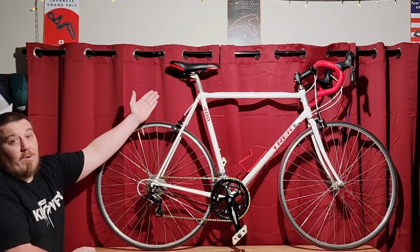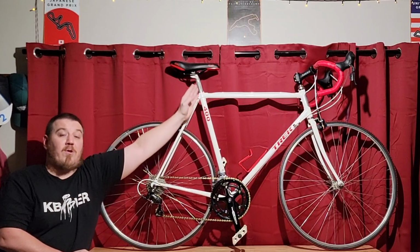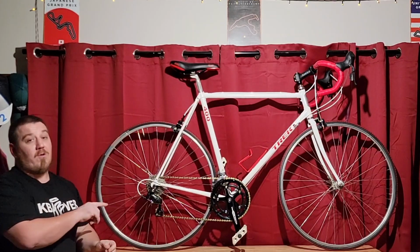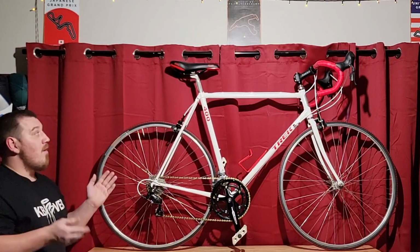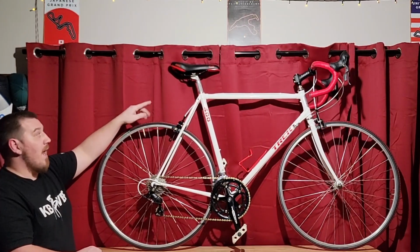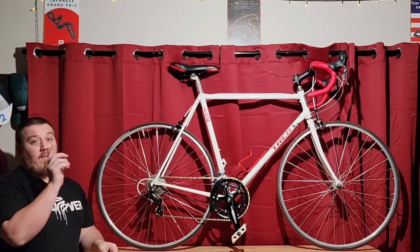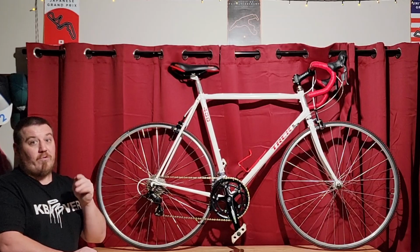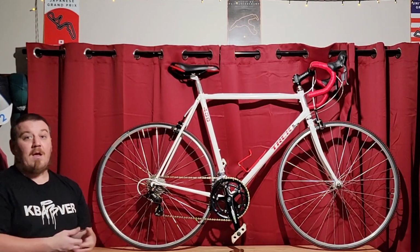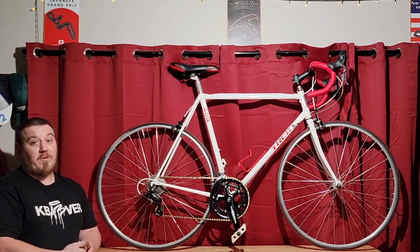Often with the seat posts as well, you could get a slight setback like this one has, or move it up forward a little bit with a zero offset. So these are things to think about. And I did not want to forget, specifically when you go steel frames, looking at budget bikes, you'll run into stuff that people don't get a lot, like this bike. This has a 26.8 millimeter seat post, so I didn't want to forget to mention that. The True Temper RC2s use the 26.8. If you go on Sheldon Brown, they say literally every American-made steel frame bike uses 27.2. There are some exceptions. I've run into them multiple times before.